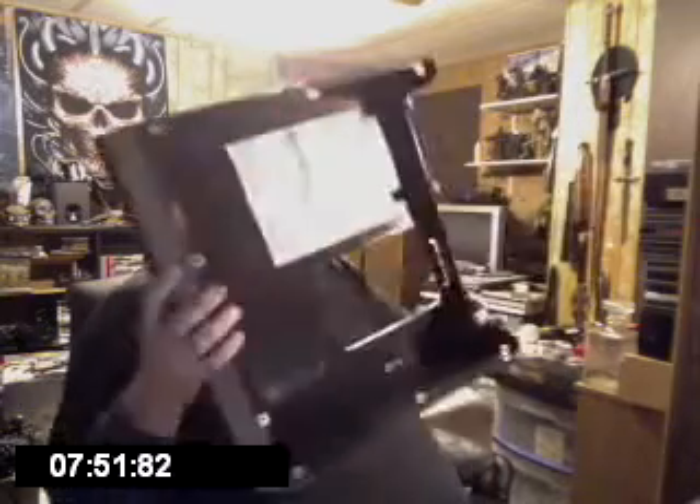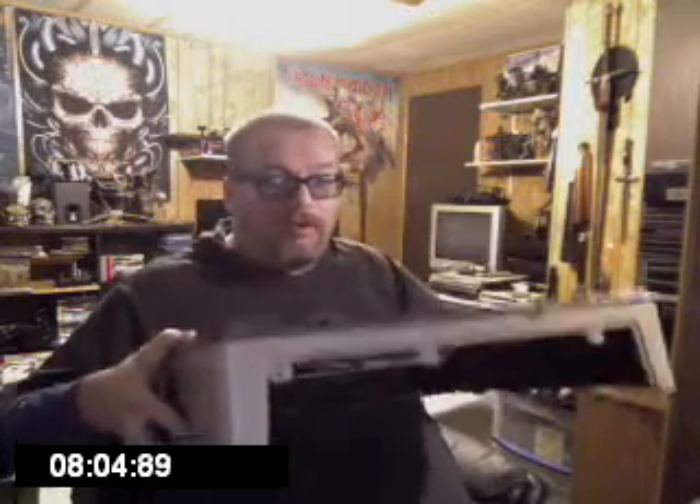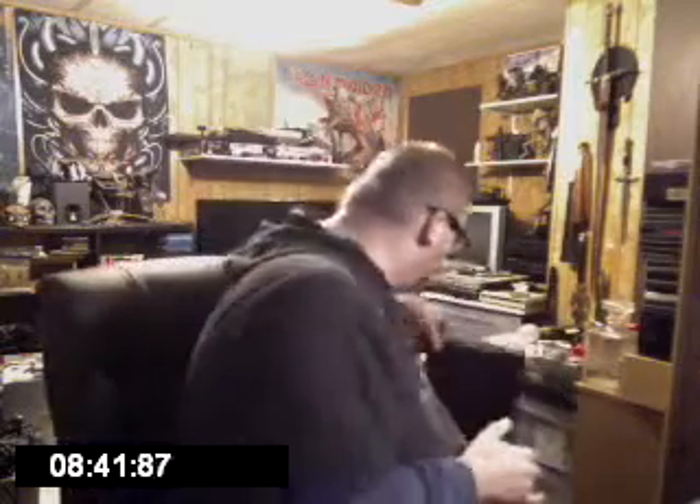The one thing I found that was cool: on the lid — this is pretty much all I took off, the main lid, just a really big lid — be very careful taking this off. I recommend grabbing it from the sides and just gradually lift it off, back end first, and have the main switch in the play position — easier to get it out. But this piece of paper right there — that is for the technician, and I'm surprised it's still in here and in good shape. It shows the schematic of all the circuitry, all the chips, spots on where to put oil or grease. So for anybody familiar with this kind of stuff, here you are — you've got a schematic so you can troubleshoot if you've got one that's broken. Very cool. No need for a technician's manual on this.